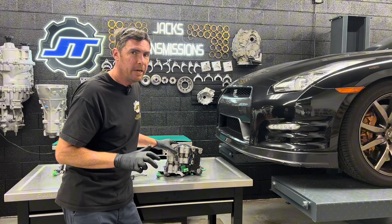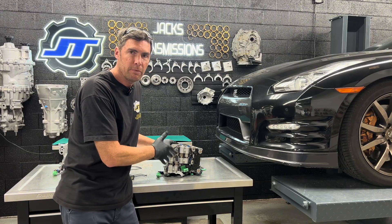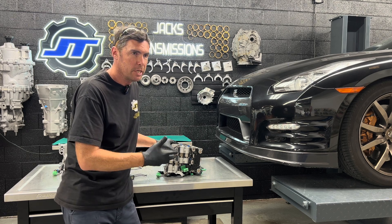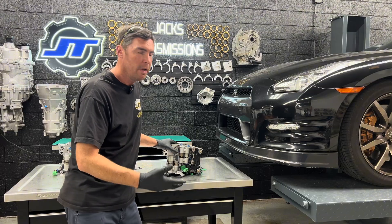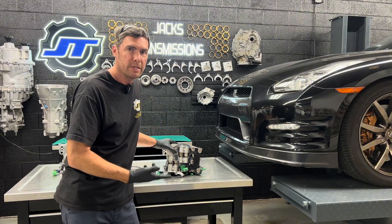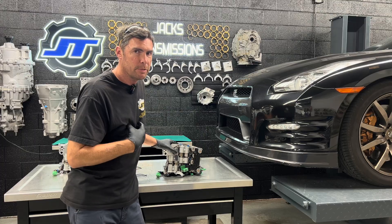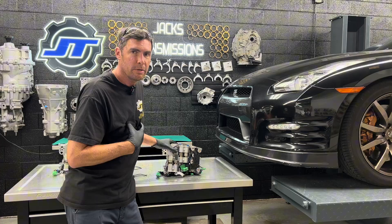In fact, you're going to take it apart, find the filters already clean, clean them anyway, put it back together, and it's never going to work right again. You just broke it. Leave it alone. Avoid the urge of opening this valve body and tearing it apart and cleaning it. Cleaning a valve body doesn't do anything unless you had a catastrophic failure — a broken gear, a broken retaining clip, something where metal got all over everything and into every little orifice inside the trans. Then you need to take it apart. But that's my job. If you need the valve body rebuilt completely, send it to me.